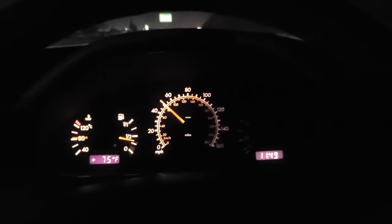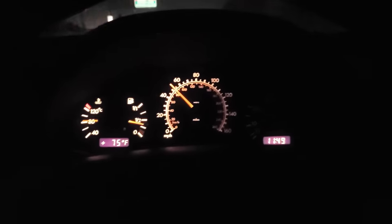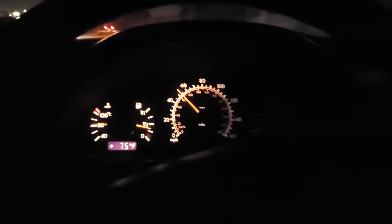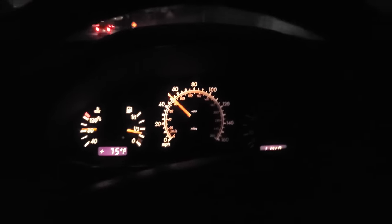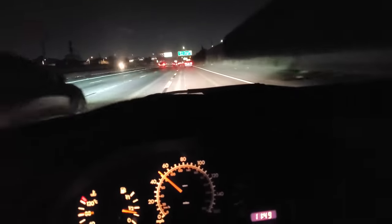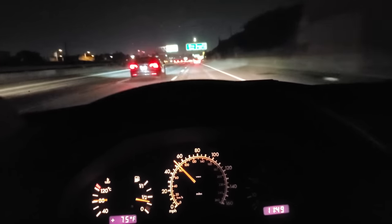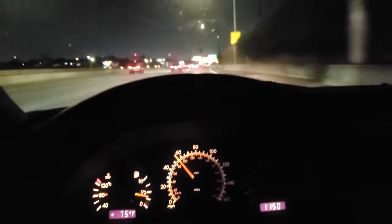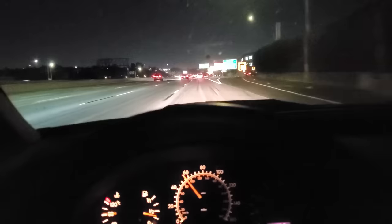Taking the car out on a little light cruise to complete the rest of the monitors. To complete monitors, just cruise around 50 miles per hour — you don't really want to go 65 or 70. Just stay 50 to 55 miles an hour, light cruise, steady. A lot of people think the faster I drive the better it'll work, but that's not the way a computer works. So check it in the morning and see how many monitors have completed.